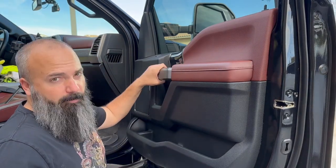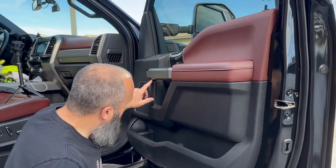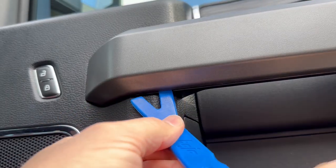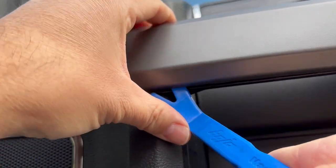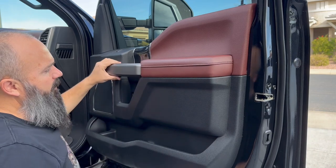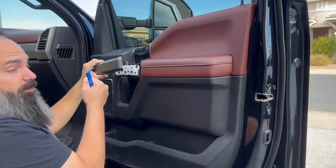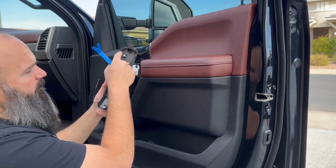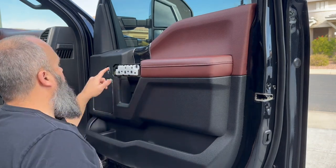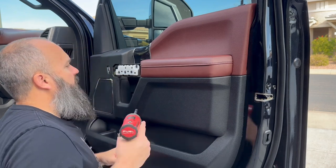To get our grab pull handle off, there's a small little opening here on the bottom to get your trim tool in, and then you can pop it off. As you're popping that off, your retainer drops in on this side — you don't want to pull this side out or you'll break that off. Your plastic tabs are holding it in. Again, your two screws or bolt heads.